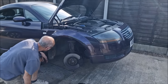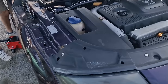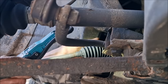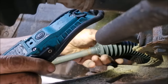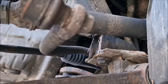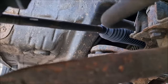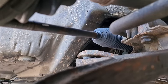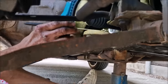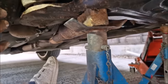We've opened the bonnet to see if we can see down in there — that was a waste of effort. Let's get a mirror to check it — it looks on. Just want to make sure it's located in the right place, all the way on and not twisted. It looks a bit silly if you go for an MOT and the tester says the steering rack boot hasn't been fitted properly.